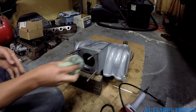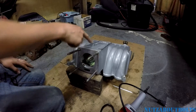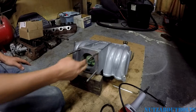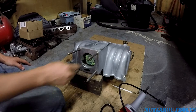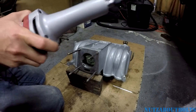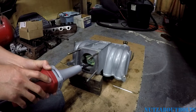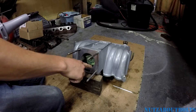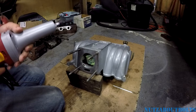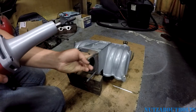One thing I forgot to mention in the video: it might be a good idea to put a rag in there, because this is a used manifold. There's a lot of oily buildup inside, and metal shavings will get stuck to that and be hard to clean out. By stuffing a rag in, you stop the shavings from going too far in. Also, be careful not to catch your die grinder in there. I just made nice smooth, light sweeping strokes with it. You don't want to hold it in one place too long or you'll get an ugly divot. Apply light pressure — the high RPM does most of the work. Just try to apply even pressure with sweeping motions for a nice smooth cut.